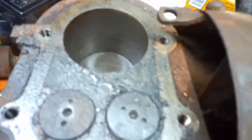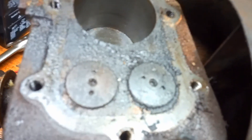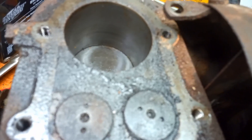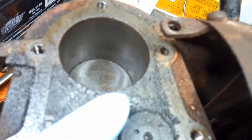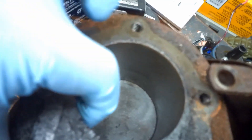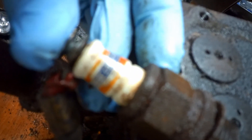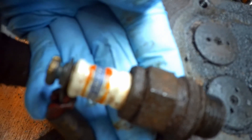I took off the head gasket while you were gone. I gently tapped the stuck valve, but it's going to take some more work to get that free. You can see all the carbon. If you look down in the cylinder, the bore is not bad — I can't see cross-hatching anymore, but there is no ridge. I ran my fingernail over it. This is that Cross Country spark plug I was talking about — it doesn't seem to want to focus.